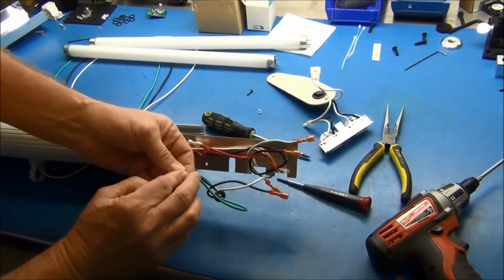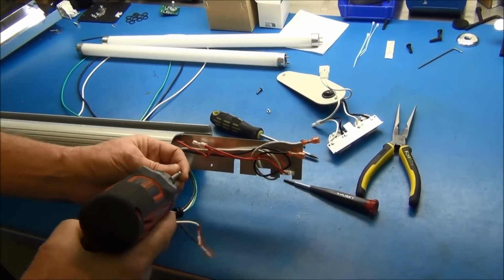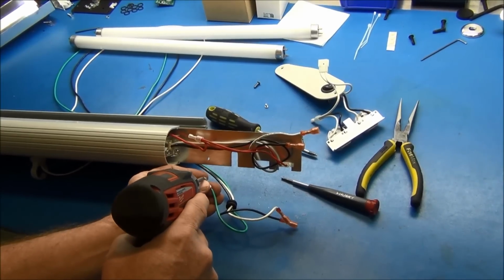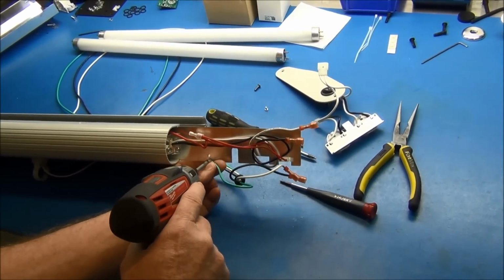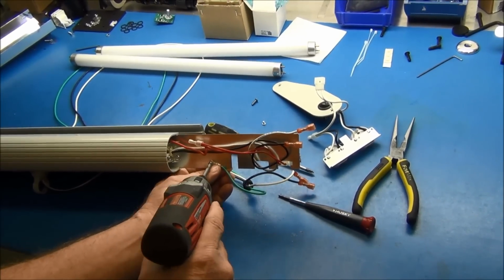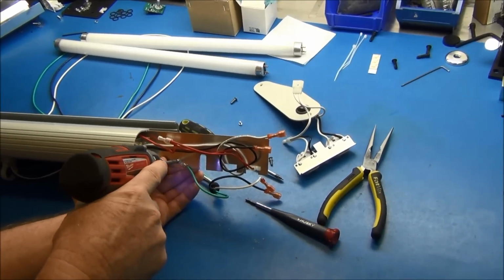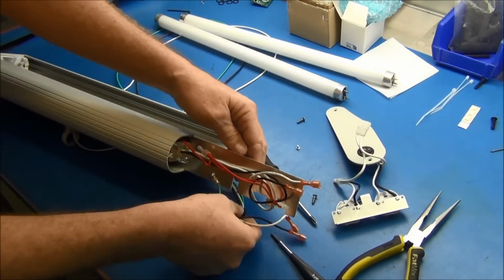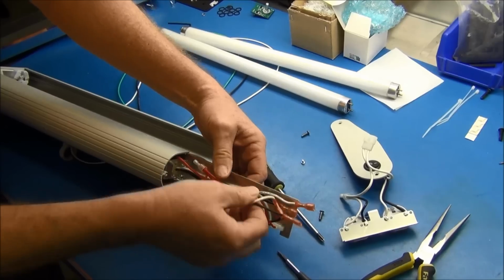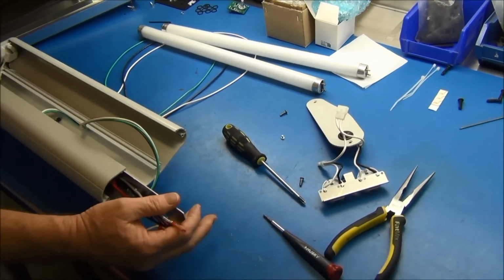And this is one of the things people do forget. Your ground wire does get connected right to the ballast plate. Put your grommet in where the slot hole. Leave your wires, your black and your white, out far enough. You can finish putting it in.